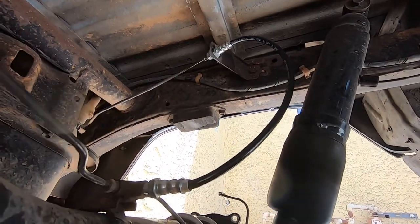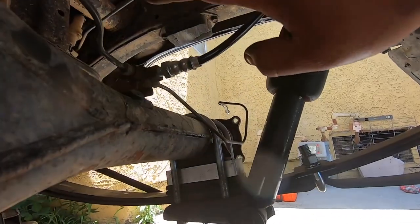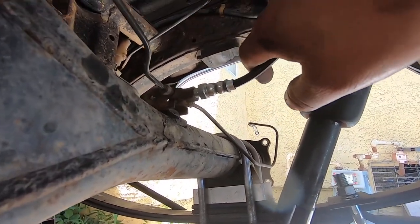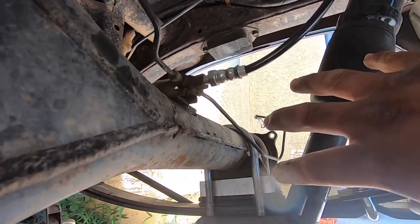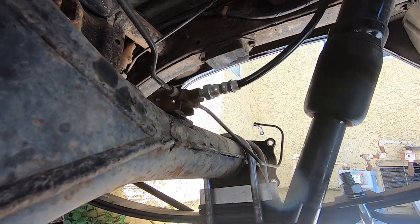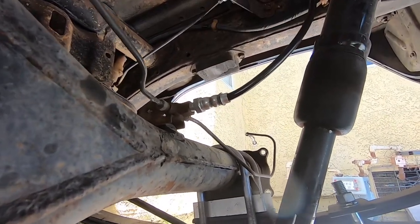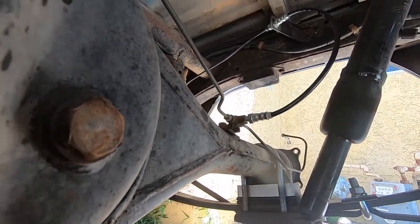So that's the line installed. We're gonna save the other two brake lines for another video. For now we're going to focus on replacing the axle seals. We wanted to do this now because we're gonna replace all the brake components on the diff, and since the brake fluid is gonna have to get bled out through those new components anyway, we wanted to do it all at once instead of doing the brakes and then replacing this later and having to bleed the brakes again. That's it for that side — let's go ahead and take the axles to the shop.